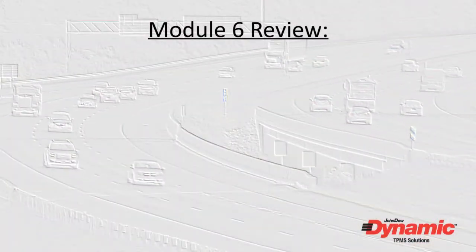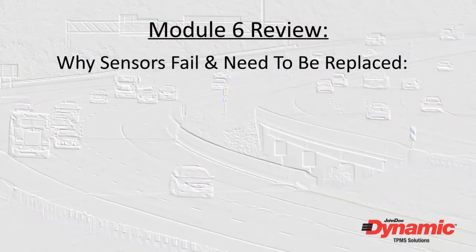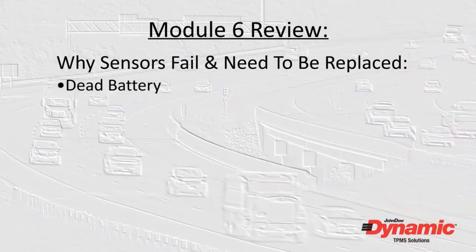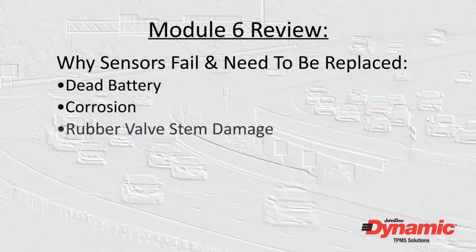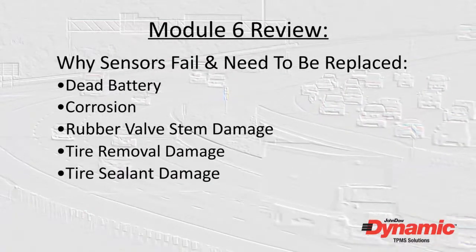Now let's review Module 6. We covered the common reasons why TPMS sensors fail and need to be replaced. Those conditions include dead or failing battery, corrosion, rubber valve stem damage, tire removal damage, and tire sealant damage.